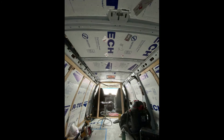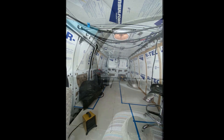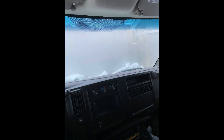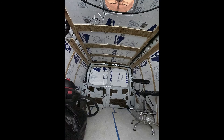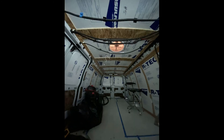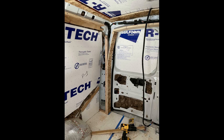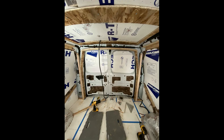I did have to relocate some wires that I'd attached to the ceiling of the van, but that was fine. The van started retaining heat after I insulated the roof — I could tell by the condensation on the windshield, which had never happened before. I added 3-inch plywood strips to the roof to span the gaps between sheets of insulation; these boards would later be used to attach the ceiling panels. I also added insulation behind the boards to fill any remaining gaps, and boxed in the back of the van with insulation and boards to create a flatter surface for building cabinets later.